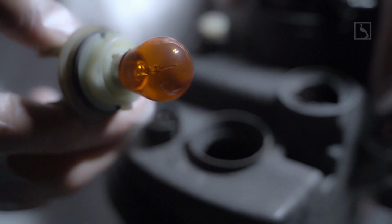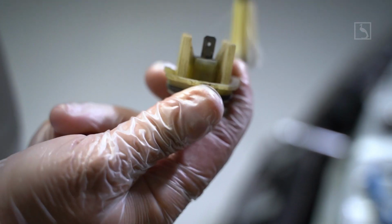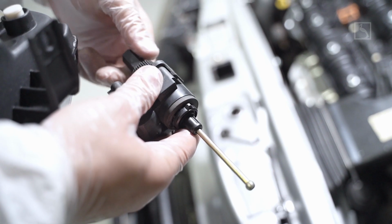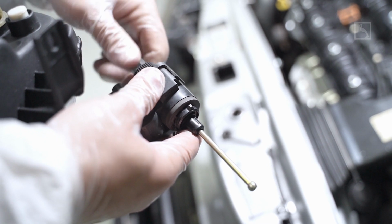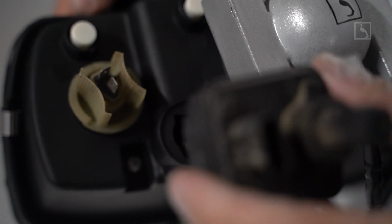Transfer to your new headlights any accessories not available in your new headlights package, like hazard bulb sockets, leveling actuators or position bulbs. Be aware that with the aluminum low beam cover cap setup, the actuator and the cap are a very tight fit and this operation requires a skilled technician.